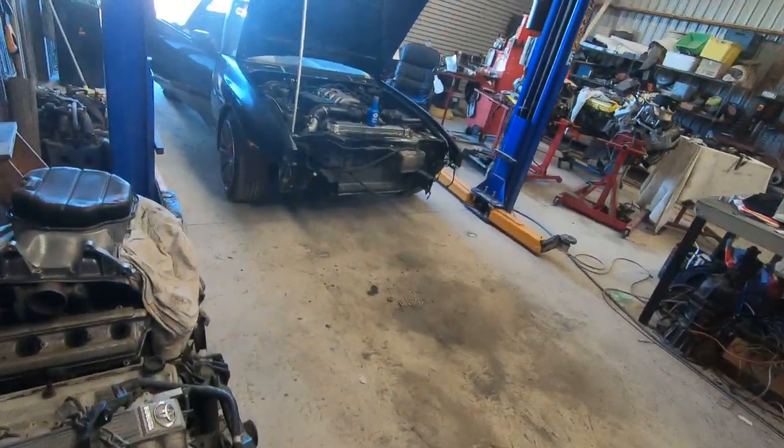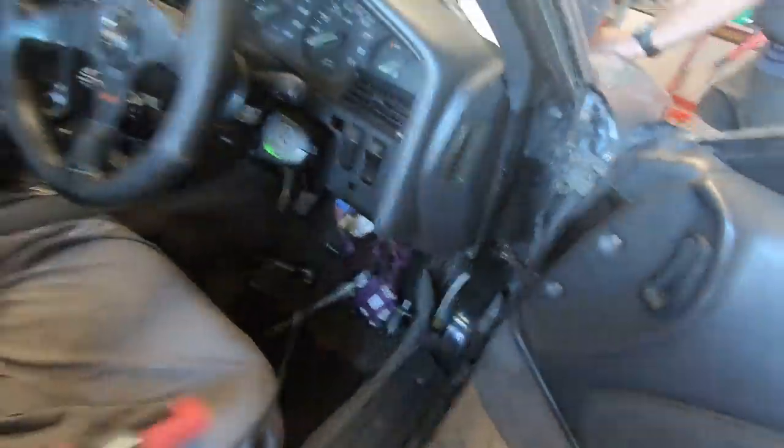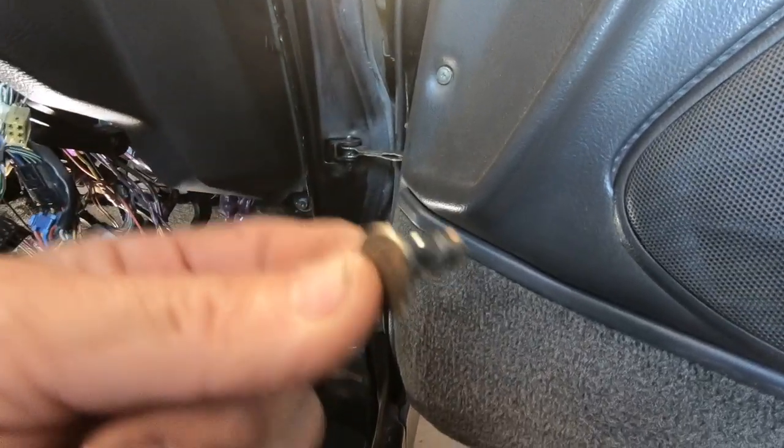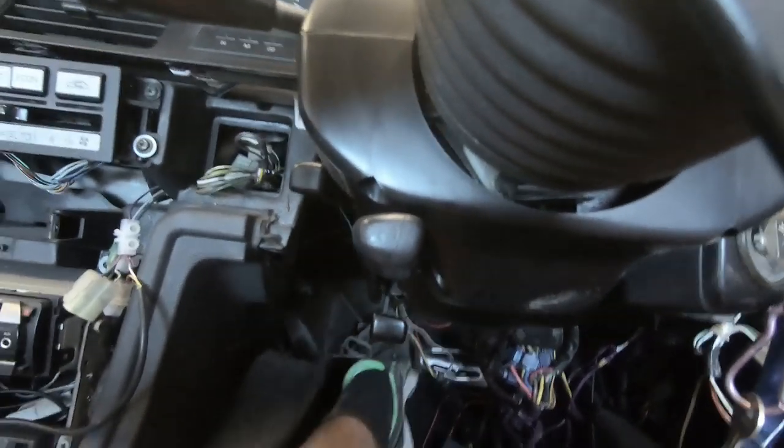Can you come guide me in please Mike? I'll go on the inside and hold it open and you give it a push from the outside. Today's technical tip: lube your pin before you put it in, because there's nothing worse than a squeak when you're pumping it. After that initial bleed outside I've just pumped the clutch a few times. This has got an internal release bearing so I've just pumped it like that.